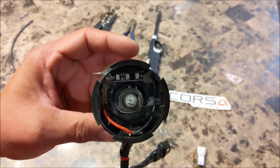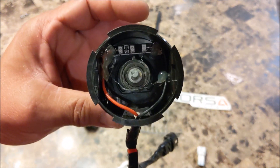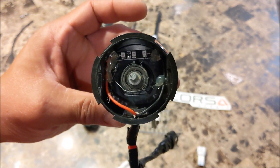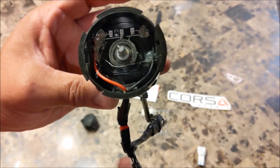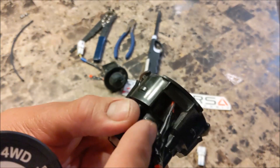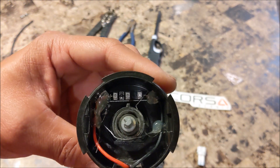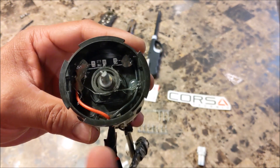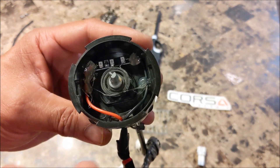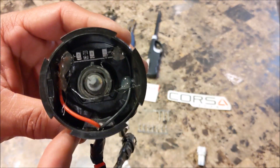That's what it looks like inside without the LED. I basically just took LEDs I had — these are from my old drone racing business — soldered them onto some leads, and hot glued them in there. There's already a hole at the bottom of the switch to feed the wires through. The Yamaha light switches are the same exact things, except they have an LED already in there pre-wired.